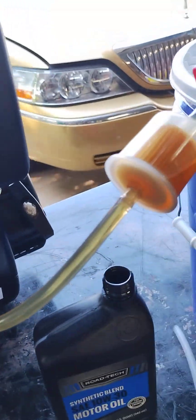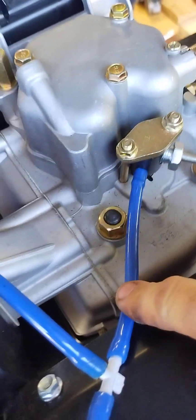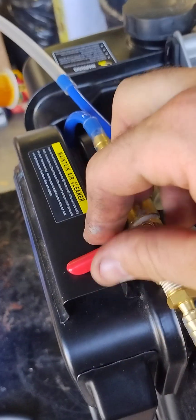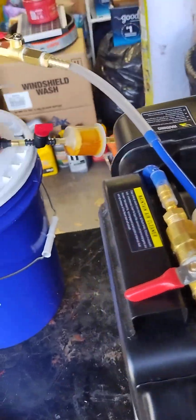Sorry, I know I promised no takes, but the good news is we have fuel and we'll have to see how that goes. Alright ladies and gentlemen, we are back. This is how I've wired this in — this is the return line. We've got it teed: one line has a filter and it's going back to our secondary tank, which has a cutoff. And this is the other side of the tee that's going to go back to our diesel tank — and this is cut off, so it's not returning to the diesel tank with any luck.